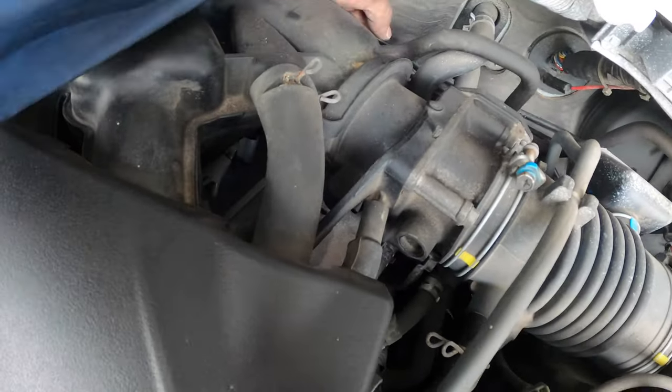All right, so I've got all the spark plugs completely replaced. Another key point for this particular plug, the middle one here: there's not much slack. I could have stretched the wire a little bit to pull it out, but I would suggest undoing this connector by pressing on the locking tab here and pulling out the connector to replace it. It makes it easier.